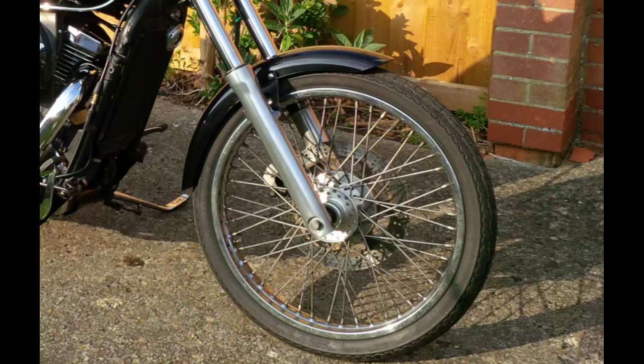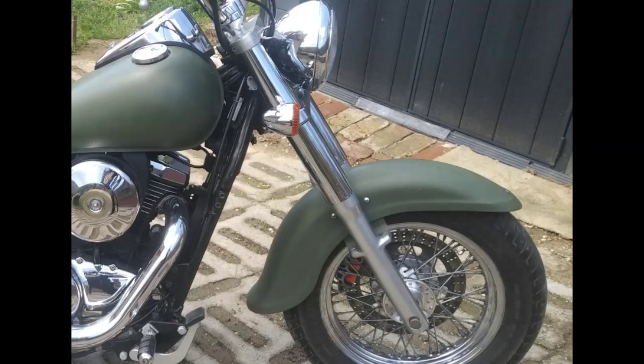Classic and Drifter models have shrouded forks. The fork seals last a long time, as there are no rock chips to impact on the stanchions and make them rough or damage them. Obviously much less road grime to get in there to eat up the rubber sealing lips, so in that regard they are a bit better than A models.